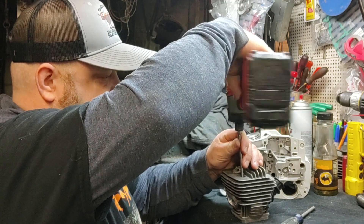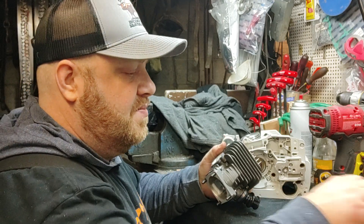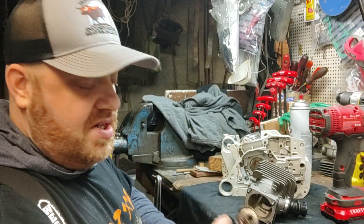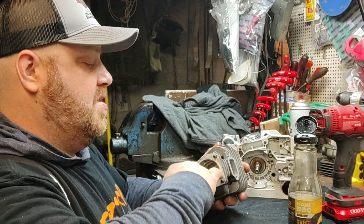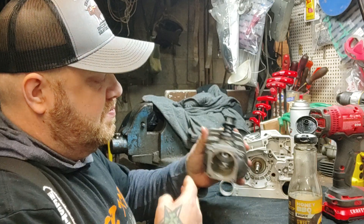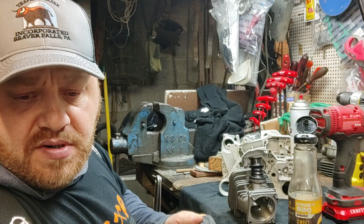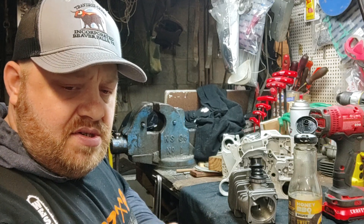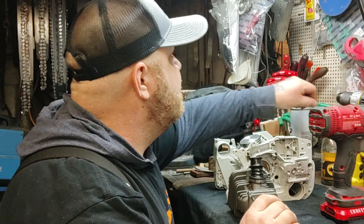The intake timing on this is crazy stock — like stupid 85, that's way too much. So I poxied the snot out of it and got it back up to 78, which is a good spot. We'll go 70, 97, 116, 78 — not super short on the blow down, but I don't want it to be a tractor, you know what I mean.